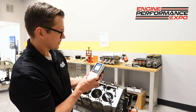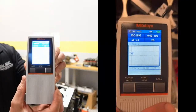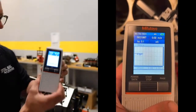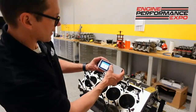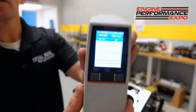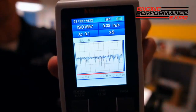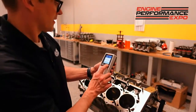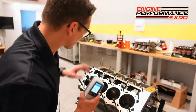So far, looking real consistent and good. The scale is 200 micro-inches, and that's the key — if it starts to get really irregular, it's going to jump off that scale. The reality is corrosion has just changed that surface quite dramatically. Has it killed the surface? That's not completely killed it, but it is definitely less than desirable to have a finish looking like that.